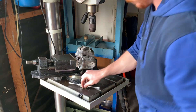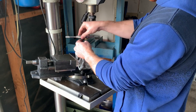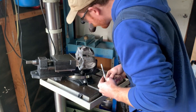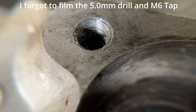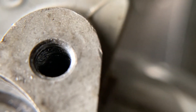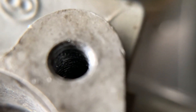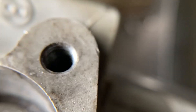I've got a number three easy out on my tap wrench and we'll see how we go — and I'm already not liking that. Now there you can see the new threads; they're not exactly perfect seeing as I just eyeballed the centre of the hole. Apart from what you can see, I should be able to make a stud long enough to grab in those threads. It's only for the exhaust, so if it leaks I can recoil it later.